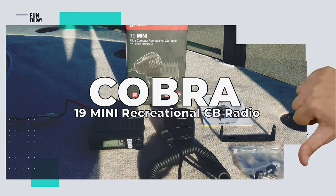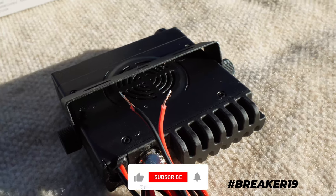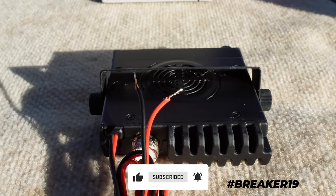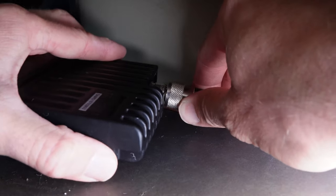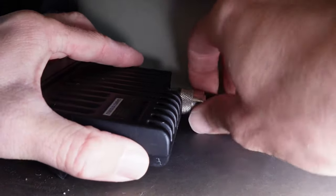So what's the downside? The lack of a working power cord was a bit of a setback, and it didn't mention anywhere on the box or the manual that a converter was needed if we didn't want to hardwire the CB into the car. A secondary UHF antenna is also needed if you still want to pick up normal AM/FM radio in your car.